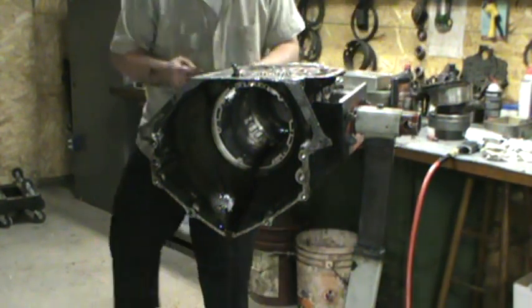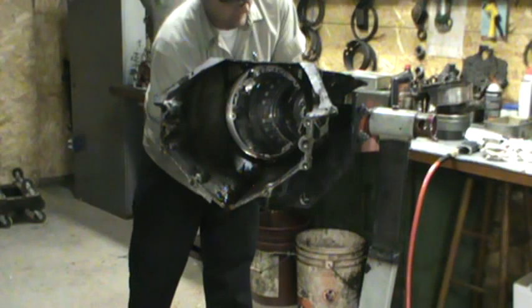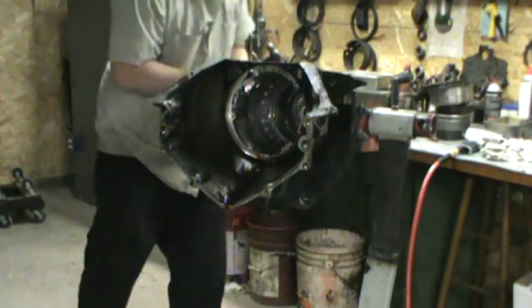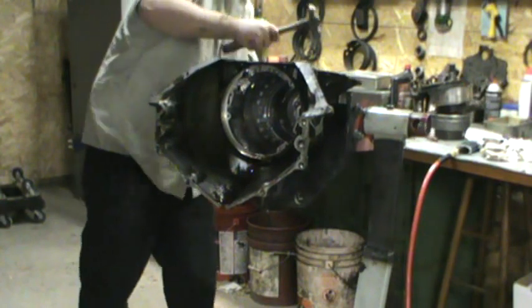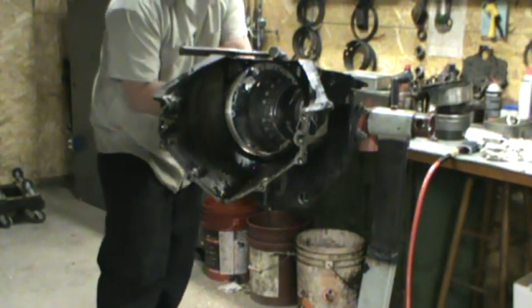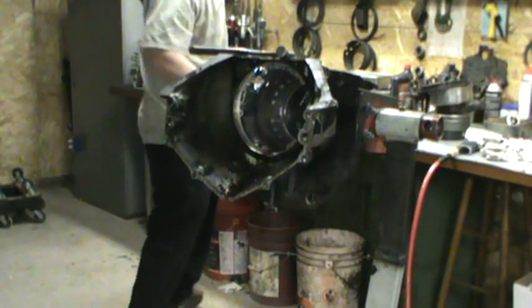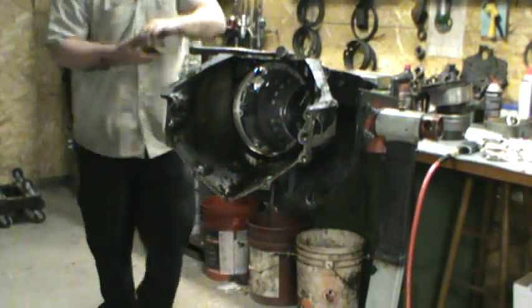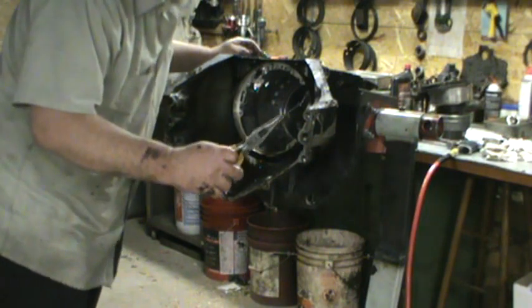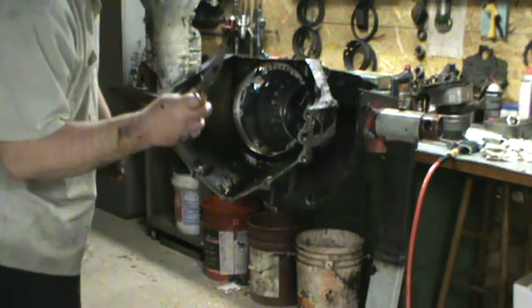I've got three minutes left. There's a bit of a wheel in here — the speedometer. And the right way to take these things out. That plug for the kickdown. Now this is where we look during teardown. We've just got to get the selector shaft out. I've got about a minute and a half to do it. There's a nail holding it in. If the nail just pulls out, nobody's rebuilt it. If that nail don't pull out and the end's kinked over, that's a rebuilder's trick — that means somebody was in it before. This is a virgin tranny, nobody else has been in it.